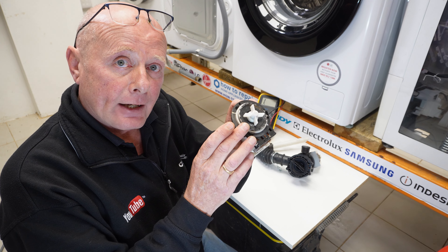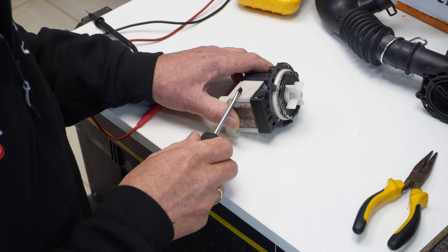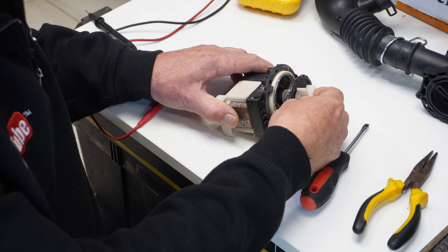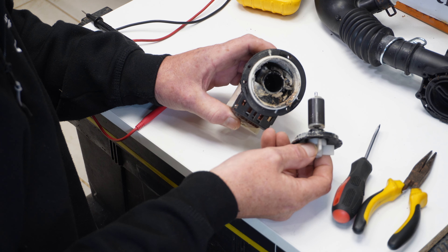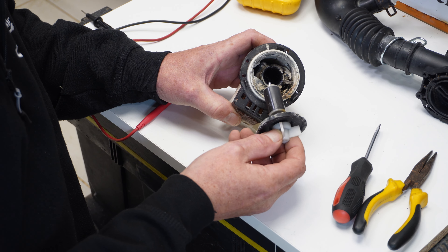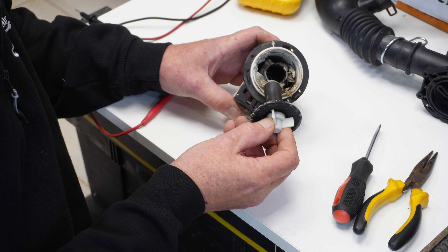You are able to separate the actual armature and the impeller away from the motor housing and the windings. To prise the impeller and armature away from the motor housing and windings, you can either use a small screwdriver and go underneath the plastic to lift it away, or possibly use a set of pliers. Once this comes out, you will always find an amount of debris inside the pump — this is normal over a long period of time. The cooling system inside is designed to allow water in to keep the motor cool, but it does fill up with old detergent and calcium, which can cause problems over time. So it's worth cleaning all this if you do take it apart.